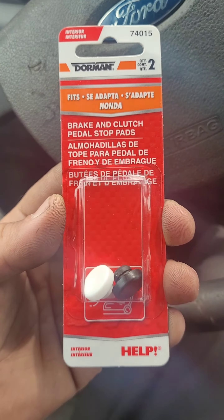Car's off, key's in my hand — brake light is off. We got a good battery, good fuse, a car that starts, and a brake light that's working properly. No amp drains, no parasitic draws. The only question left was why that 120 amp fuse blew. I asked the customer if he tried to get a jump start, because if you've got a smaller car with a smaller battery and you try to get a jump from a big diesel or something with a lot of power, it can blow that main battery fuse. Sure enough, he told me somebody pulled up with a gasoline generator and hooked it up to the battery to try to start it — that's what blew the fuse.